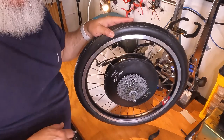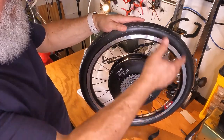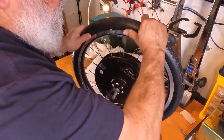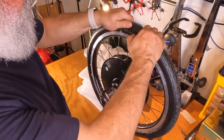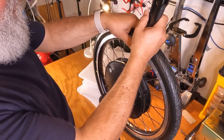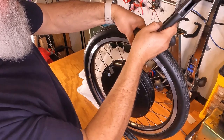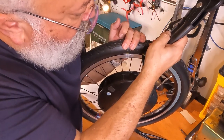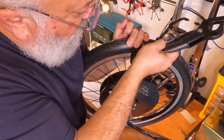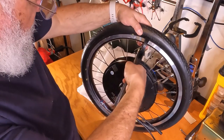Well, the camera had reset because it got too hot using 4K videoing. Anyway, so I'm flipping. I just finished this side. They're all set. I'm gonna flip over and we have a few more on this side. By the way, this P tool also has this little foot here, which I knew about but never used, and it's really nice for getting in there and shoving those pins in a little deeper. See how that worked? Okay, yeah, let's see, we got 5 pins left.